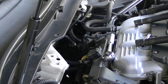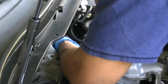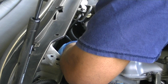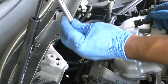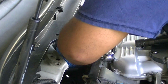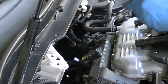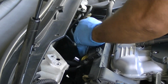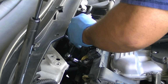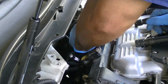So, to get back to where we were, we're going to drop the socket, the spark plug socket itself, into the 3rd hole, drop our extension in, pop it in, you'll hear it lock in. Take your socket wrench itself, pop it back on, lock it in. Just try not to get flex like me. Lock it in. Now you should be ready to go.